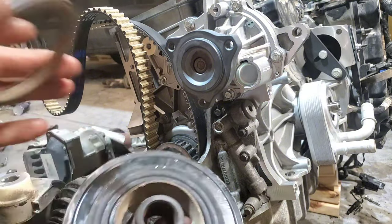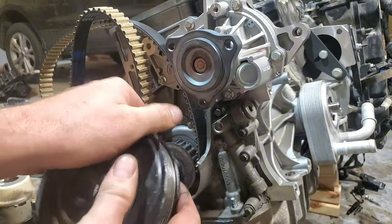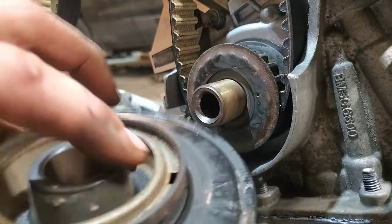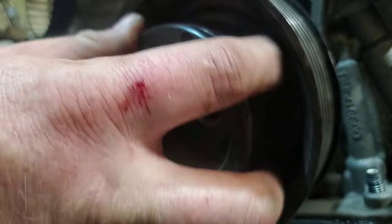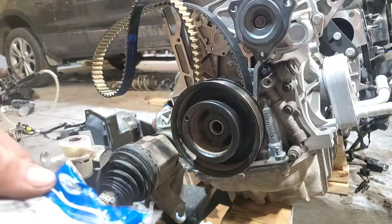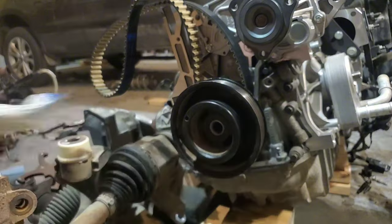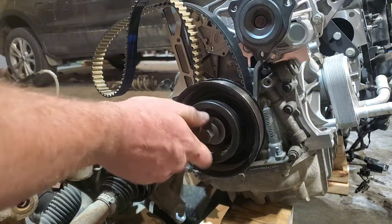Got the lower gear on. Now we're going to get the crank pulley put in, and then the little timing window for your crank sensor just kind of pops in place. There's a little timing tool in the kit — you put that on the front little bolt-in area, there's a dowel for an indicator, and you bolt it in place. Just keep turning the crank pulley until she drops into place and locks it right in there. Part number: BE8Z-6A340A. This gets torqued on — holy Jesus — tight.